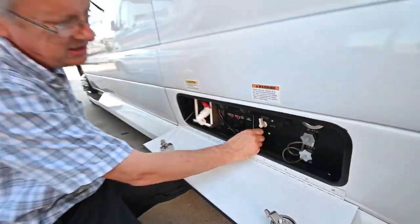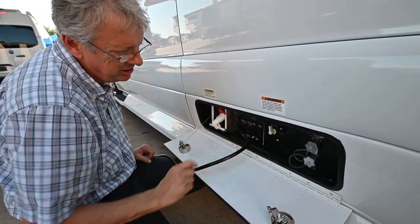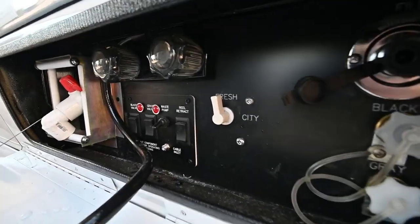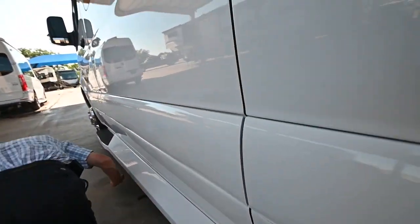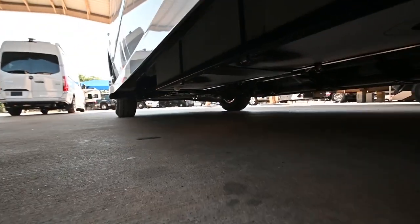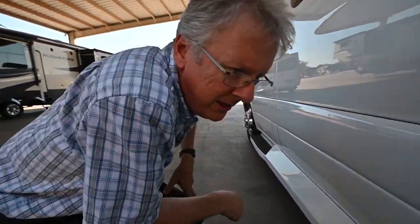If I go up to fresh water tank I'm able to fill up the fresh water tank. When I have city water coming into this connection, I just take this lever and turn it to the left and the water coming in is going to fill up the fresh water holding tank. So we'll be able to pack fresh water with us. The drain for that fresh water is right up underneath here - there's just a plug so you can take that plug out and drain the water out when you need to, or when you're winterizing.